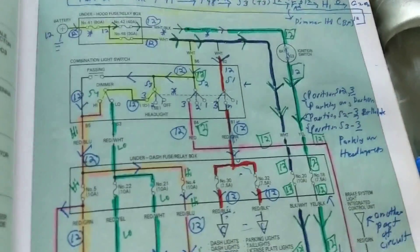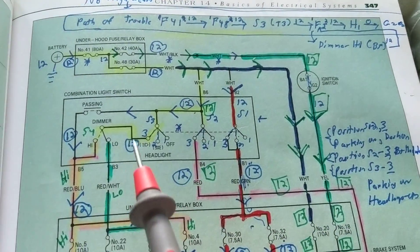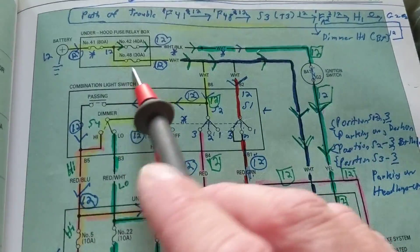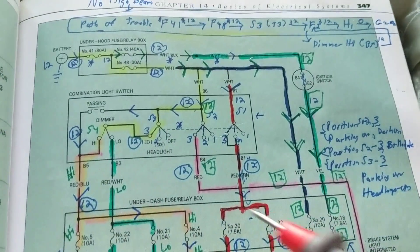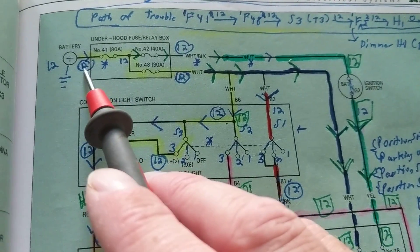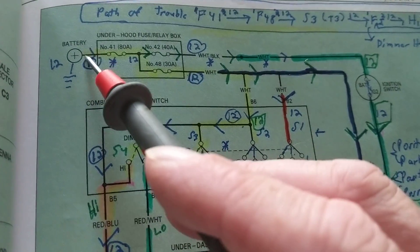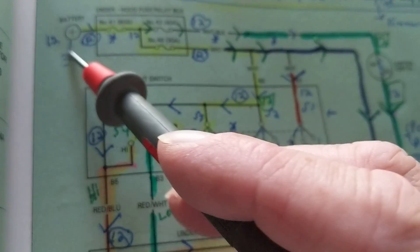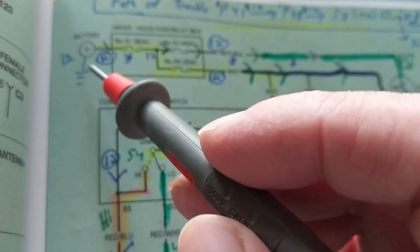Hello, welcome again. I was asked to go over the basics of automotive diagrams. We always start at the top, going from the battery towards the ground when we analyze the schematic. Starting at the top, there's a battery — for automotive, the plus sign dictates the polarity. There's no negative shown, but we know it's connected to negative, so this is a 12-volt automotive battery.